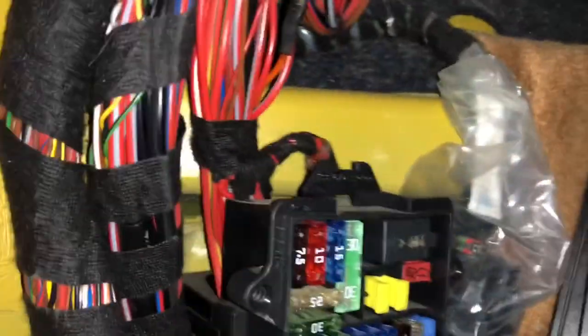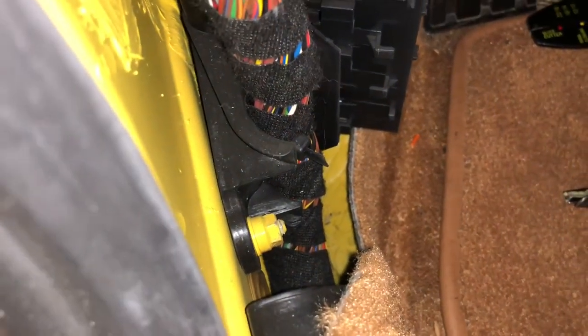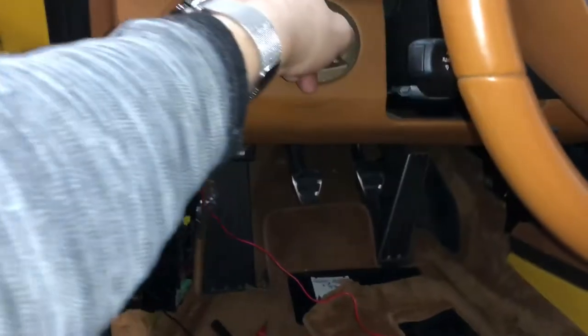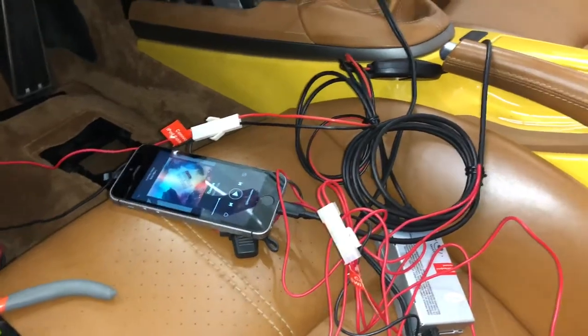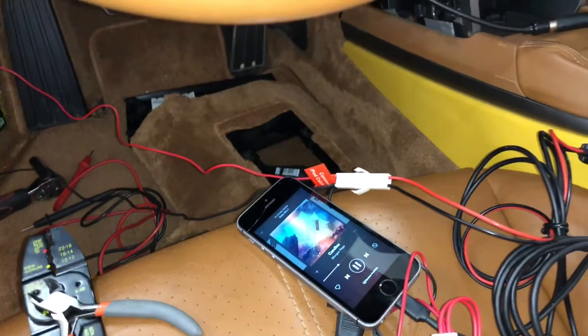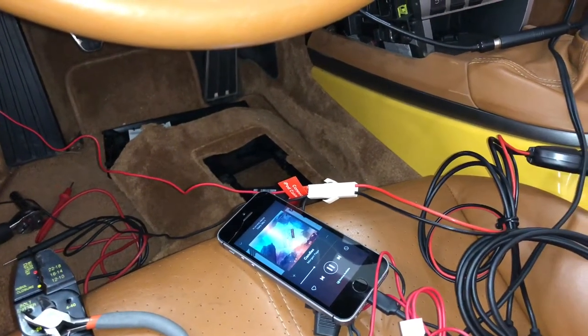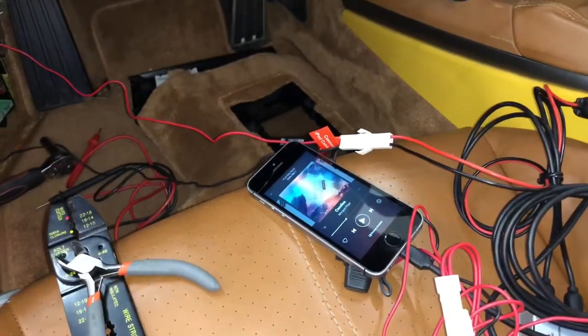There we have it — my 12-volt tap wire coming out the top. I'm going to use a spade connector and a nearby ground point to ground the modulator as well since it's right there. With it wired to the ignition: music pauses when the key comes out, key back in and the radio fires up. That'll work.